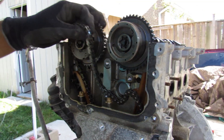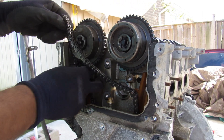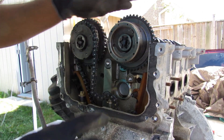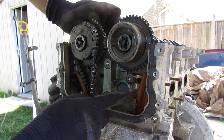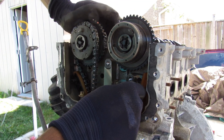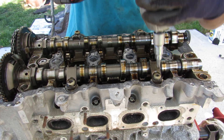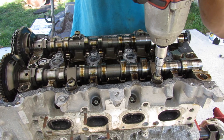Because the chain is so loose, I was able to make it fall off the camshafts. I can get the camshafts off by removing the top pieces, but to get the head off I may have to pull out these little things to release the slides. I'll go ahead and remove the Torx bolts holding the camshafts down and remove this camshaft.